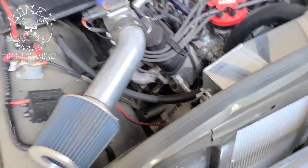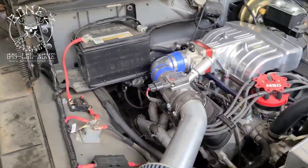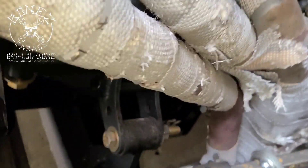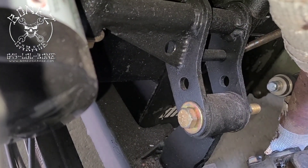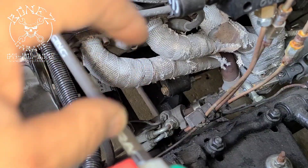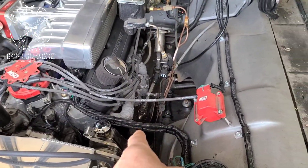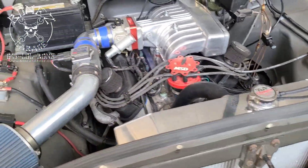Now everything's really nice. We have all the wiring that we did — there is so much that has been done to this truck, it has come a long way. You can see when I get down there how nice the motor is fitting. It doesn't hit anymore. We made new motor mounts for it. We cut out the cross member down there and now the cross member does not hit the oil pan anymore. Then we took solid steel bar and put it all the way across towards the front to reinforce it, to make sure what we cut out isn't going to weaken it. It's all welded in, plug welded, and we capped off what we cut — it looks beautiful.